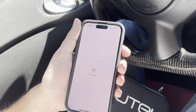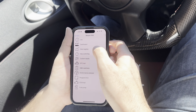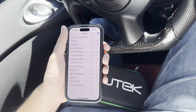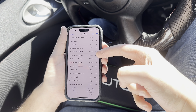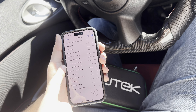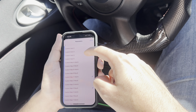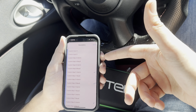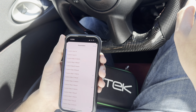So this is the data logging process. Click on my car, then click on data logging. This is the part that customers usually get confused on. To add custom channels — I usually ask for a couple of custom channels and you'll see them on mine already — you just hit the gear icon. It's alphabetical, so you go to C. These custom map boxes, depending on what you get in your email for instructions, you're going to want to check one or two of these. That's specific to the customer, so don't overthink that part.